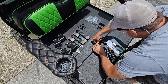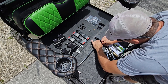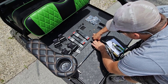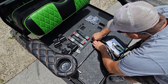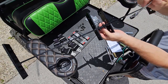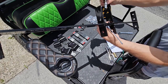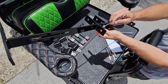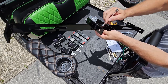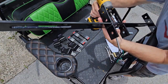This is a pretty simple, easy kit. Once you put the bracket together and mount it to the back, you just bolt the belts down — there are single bolts for each one with lock nuts. You can use a ratchet to start, but then tighten with a wrench. Ratcheting wrenches save you a lot of time here.